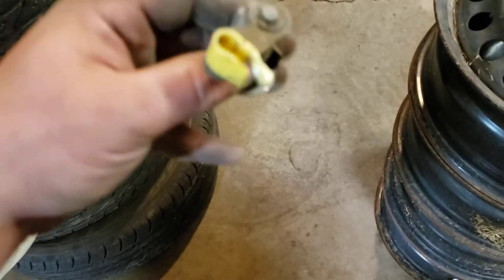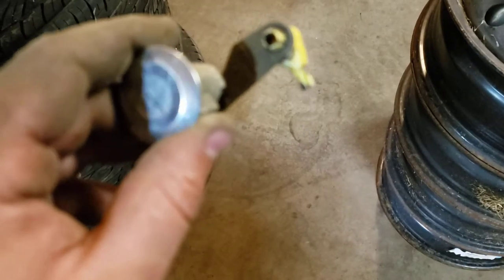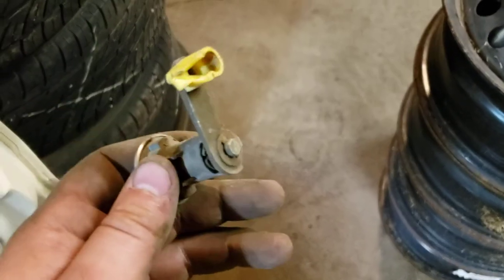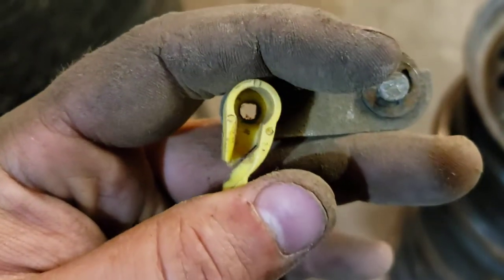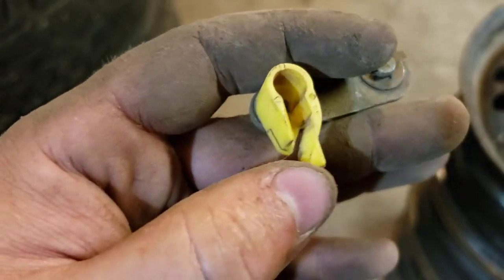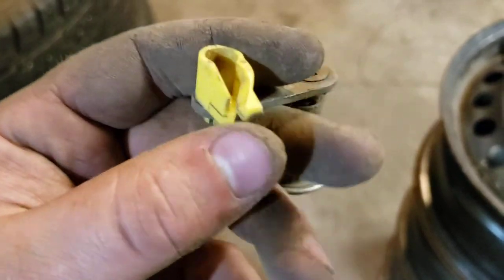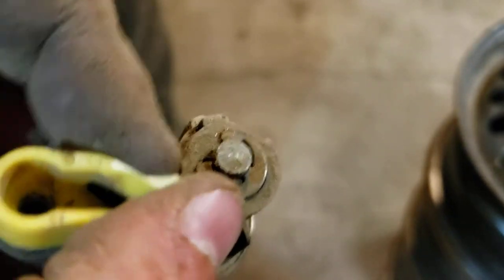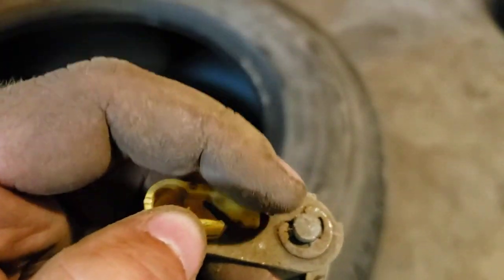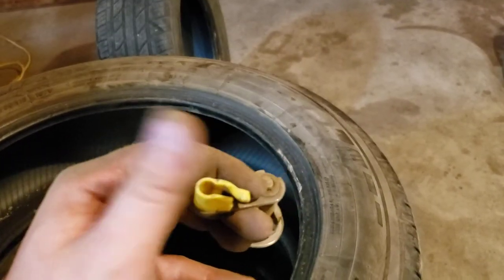This is the little clip you'll fight with a bit. They've got this little yellow tab with space underneath it — the lock rod goes into that and then this clip gets clipped behind it. What you've got to do is bend this flexible little bit, push it this way and behind the rod, and then you can just slide the rod right out.